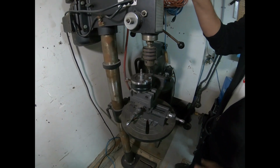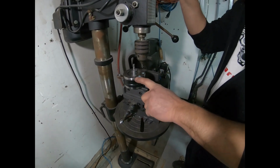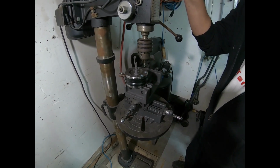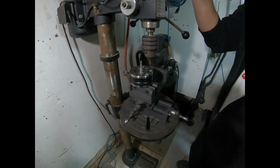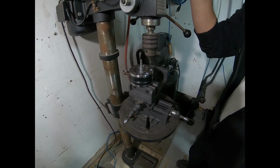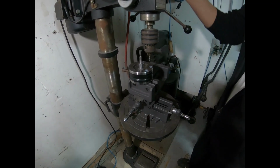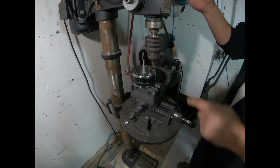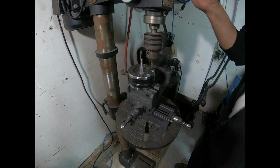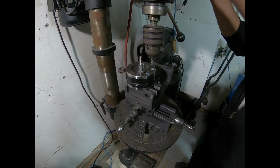Okay, I got the crank into the drill press. I've marked out my marks that I'm going to drill. I've done the balance factor. I'm going to try for 60% over rotational mass, and I got a pilot bit in here to start it to guide the larger bit. It'll help it out so that I get a straighter drill.